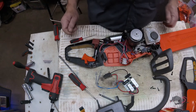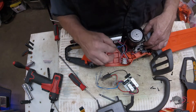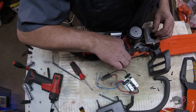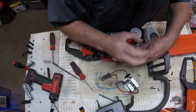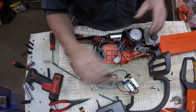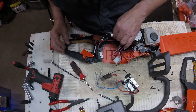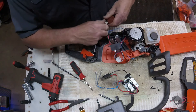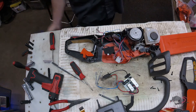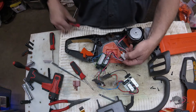Take note of how tight the screws are on that junction block — I've seen those blocks melted before. I'm pointing to a track that the blue wire runs through; when we put it back together we'll make sure we get the wire in there. That wire is coming off of the chain brake switch — there's a mechanical brake and an electric switch. Disconnect the trigger switch; I've had to replace a couple of those triggers. Then we'll disconnect the main power wires from the junction block.